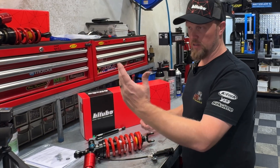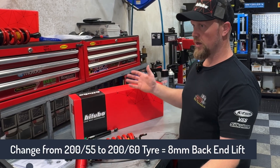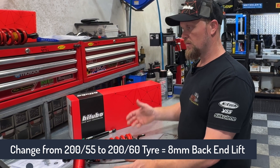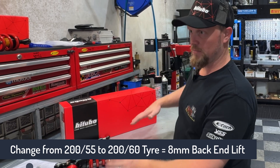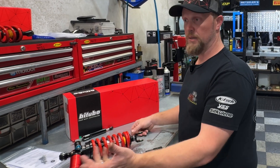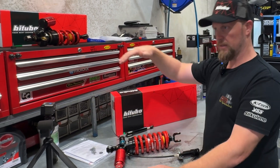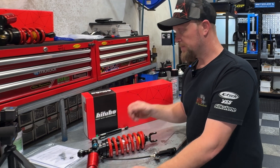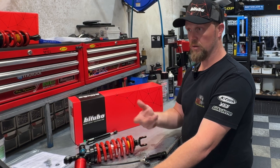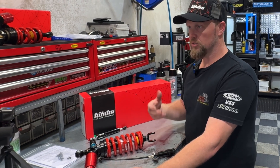When you put a bigger tyre on the bike, if you liked how the bike behaved before that bigger tyre and were just looking for more traction, when you fit the big tyre the bike raises the back — about eight millimetres actually. On BMWs, there's a standard flip chip, and if you flip it to the low setting you'd drop the bike back down. But as we discussed, BMWs ride too low for good cornering performance, so adding that height makes it really nice — you're essentially transferring weight to the front.